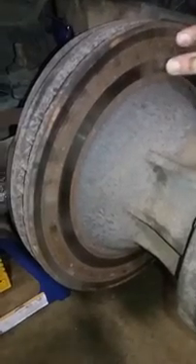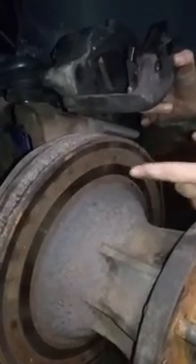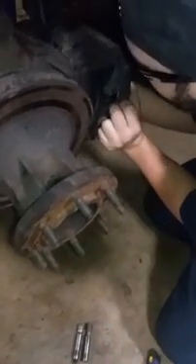You can see these pads aren't too worn — they have some life in them, nice and thick, maybe a little grimy but they look good. On the rotor you've got some rust. This patch right here is lower because it allows rust to build up, whereas these two spots where it's grinding and being cleaned constantly are higher. That's not ideal but it's accepted. We're going to put this caliper back on, which isn't the easiest with rusted rotors, but it's on.